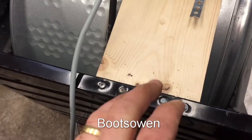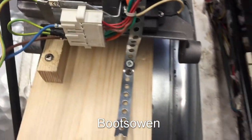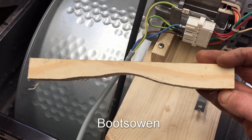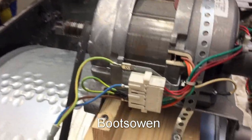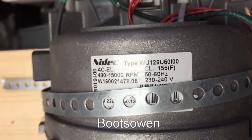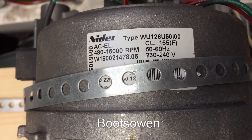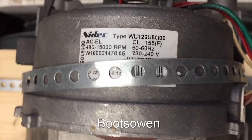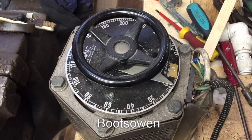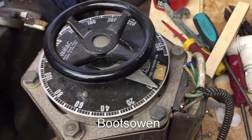I've got it all reassembled. I've got a piece of wood screwed in underneath each side just to get my spacing correct. Then I've got the motor mounted — in a piece of wood with a bit of a hollow in it just to hold it on one side, and then a strap to hold it down on the other side and give it a bit of tension. I've got the motor hot-wired. The motor is a NIDEC WU126U50100, rated up to 15,000 RPM. I've got it plugged into a Variac which allows me to alter the voltage from 0 to 270 volts, so it should get up to 15,000. It's got a load on it — I'll bring up the voltage.